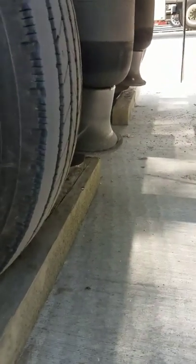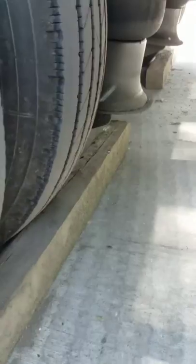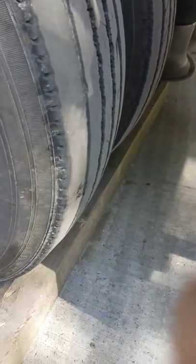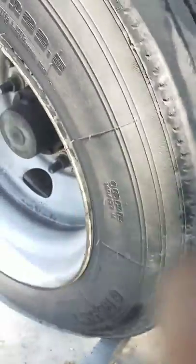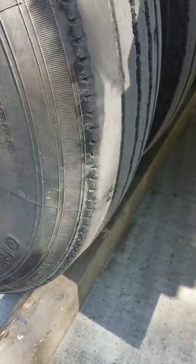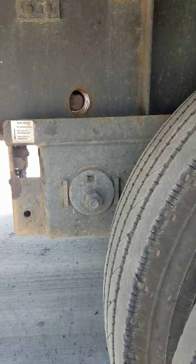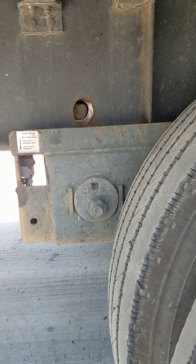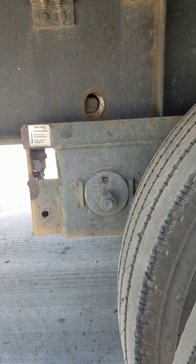You can see I got it over on the other side, putting it behind the tires and that'll hold it. You got a dump valve for your rear axle — that'll take the pressure off just enough so you can get underneath it or get it to start budging. You don't have to have a dump valve to get it to move, but before I even started I wanted to make sure my pins went in, and I had to rock it a little bit, but they did.